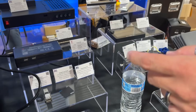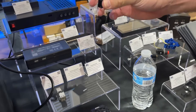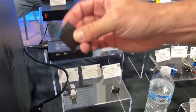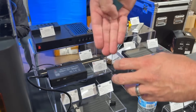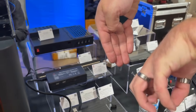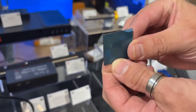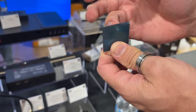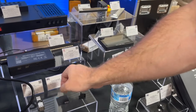Inside the printer you'll see the Panda Wiper installed, which brings silicone brush wiping to the P and X1 series — the A1 already has a silicone wiper and now you can get it on the P and X1 as well to keep your nozzle clean. There's also a nano polymer-coated piece of metal you stick on the inside of the poop chute — filament has no adhesion to it, so it just prevents the chute from backing up and jamming. A really cheap quality-of-life upgrade.